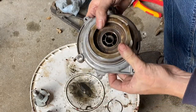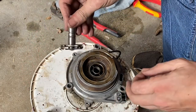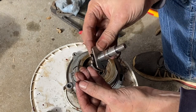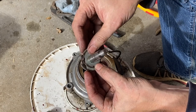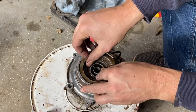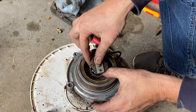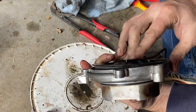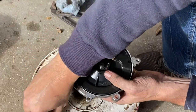We can put the cord in that little notch there for now and sit that back on. Then we flip it over - and this is probably the most important part of the whole procedure - reassembling the clip on this bolt. If I flip this over you can see there's a flat side across there, so importantly the little notch on the spring needs to come up into that notch. If you don't do this it won't operate correctly. We'll put this spring on now - put that on like that, get that little notch in, down like that, and just push it in.